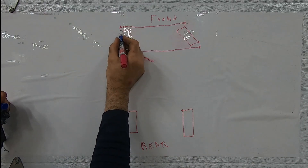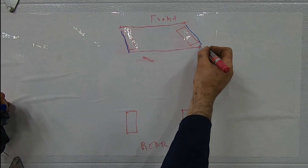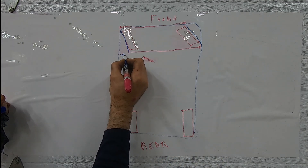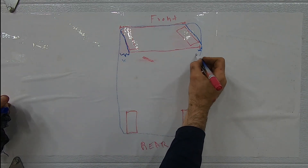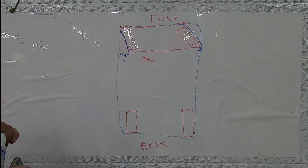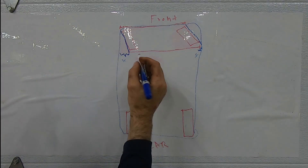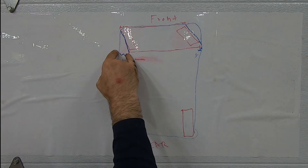What I'm going to show you today: you put the toe plate along the tire, then run a string from the back of the wheels all around to the front of the wheels like this, and then measure the distance. These two distances, X and Y, should be the same. In this exaggerated diagram there's no gap between the string and the plate on one side, and a large gap on the other — that is how you measure the steer-ahead angle. You put the steering wheel straight, block it in place, then adjust the tie rods so the string-to-plate distance is equal on both sides.